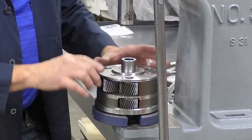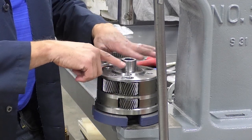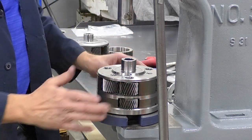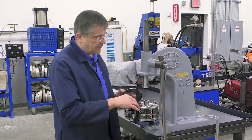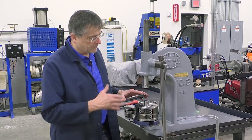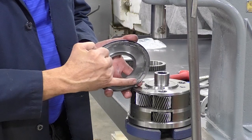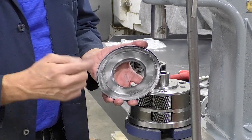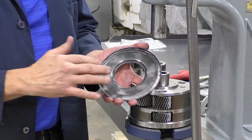The oil goes under the lube dam, gets captured, and then is forced down into the pinion pins to lube the planet. The problem is that over time and mileage, and if you have converter failure or whatever might have failed, contaminants get trapped underneath this lube plate and can accumulate to be quite a lot of metal and material in there.